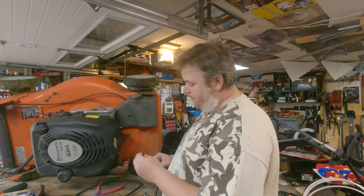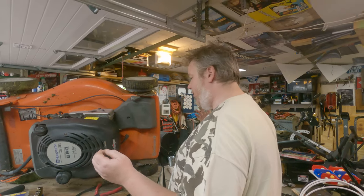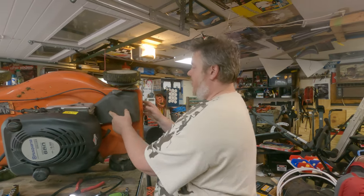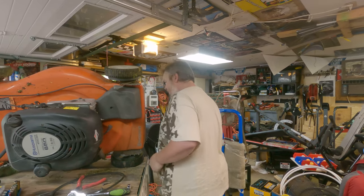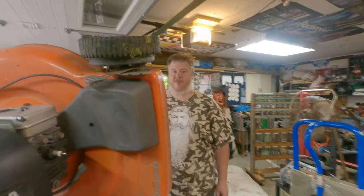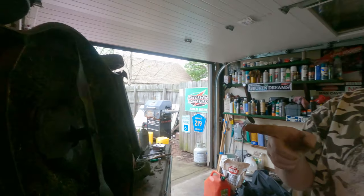The bolt I took out of this hole right here, which is five-eighths — when I backed it out I figured out that the bolt on the end was bent. Went through my whole garage hoard and don't have a bolt that size. So what I did is I put a cotter pin through and bent it, and it's holding pretty good. Come take a look at it — cotter pin's in there. I don't think it will hit the blade, but you never know. Watch out, the blade's coming.